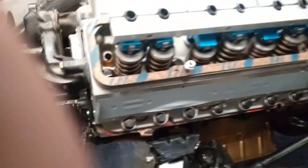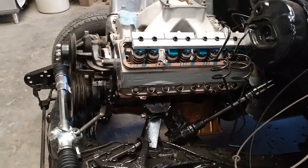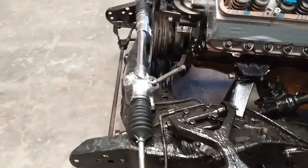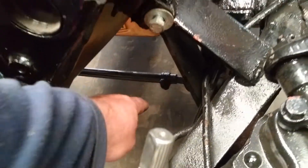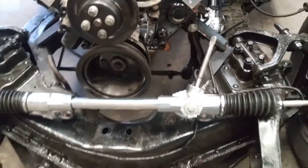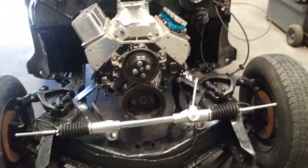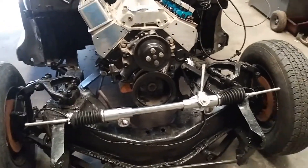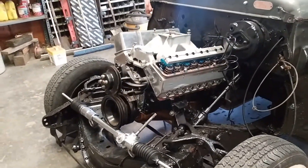The problem is I couldn't put headers on here because the steering is in the way, keeping the motor way up in the air — so it's time for a major change. I'll cut that out, figure out where this is going to be centered, and weld a cross member in the frame down here. Then I'll build the mounting holes and perches to mount these onto that cross member. It'll be a little tricky but I think I'll be able to figure it out.